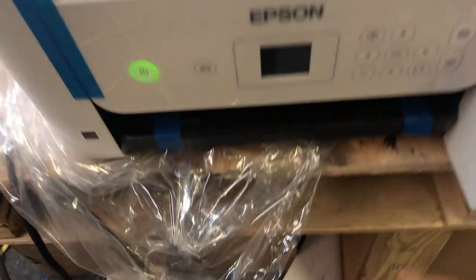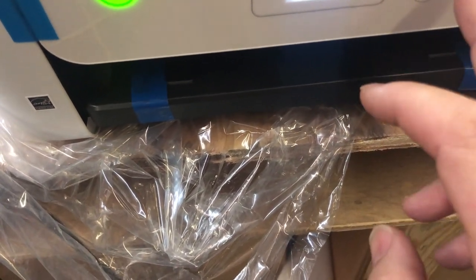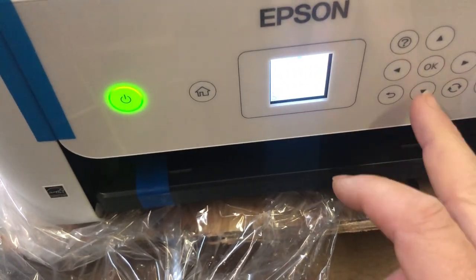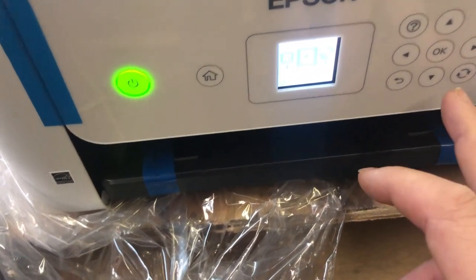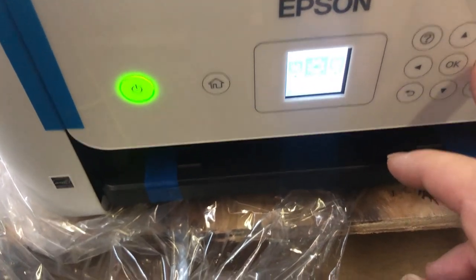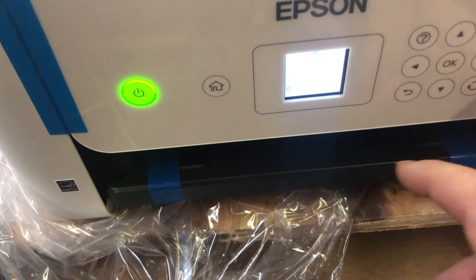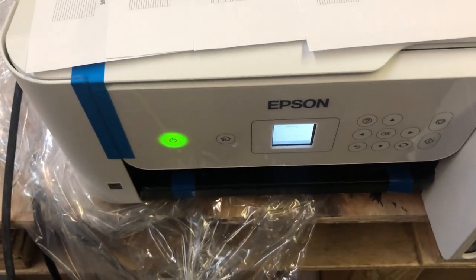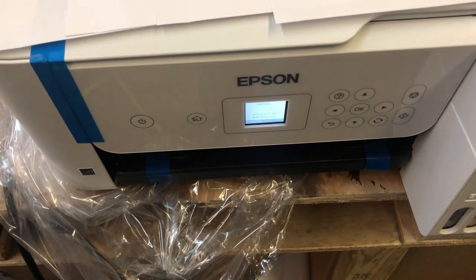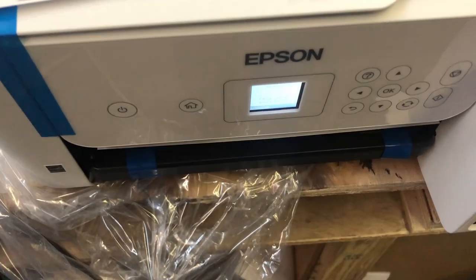What you do in this situation is simple: leave the printer untouched for 12 hours. The wetter solution is going to get dissolved into the ink. Then come back — I'm not doing any cleaning at all, I just select print nozzle check. I left it in the printer for 12 hours and came back, and it's clean. To recap: if a missing pixel is improving or moving around, we keep cleaning. If they stay at the same location, we stop and come back after 12 hours.